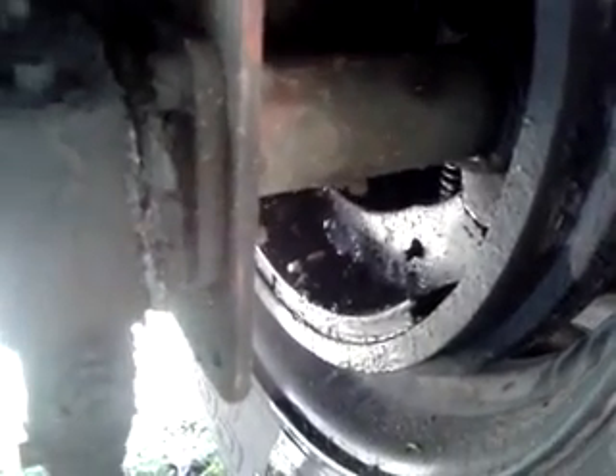That is the oil that has leaked past the seal, saturated the brake shoes, which would have to be replaced if I were to put this trailer back on the road tomorrow before it would be legal, or really thoroughly cleaned. It's a lot easier to just replace them.